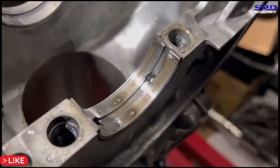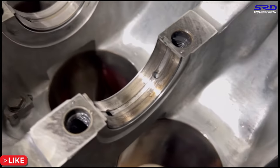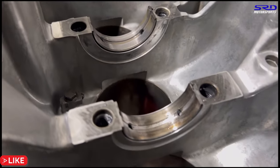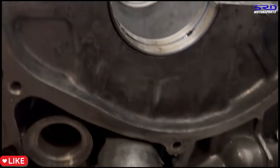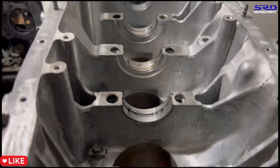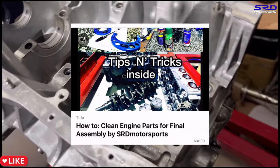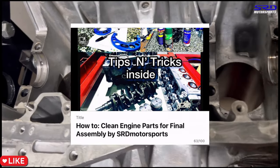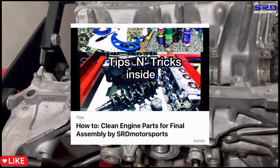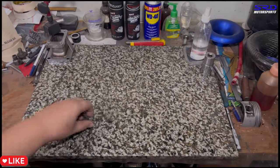And look, it probably sucked in the metal debris, it started affecting the main bearings because it went through the oil, you know, it went through the oil pump. So now looks like we certainly have to inspect the oil pump and work on it. We unplug this or loosen it so that you can clean the block properly. And you can check on the video here, but it will be in the description below on how you thoroughly clean the block and internals just to make sure there's no debris at all. So yes, let's go to the desk now.